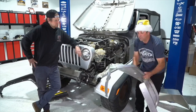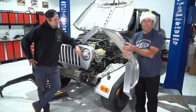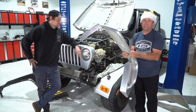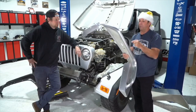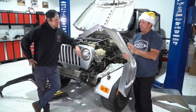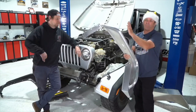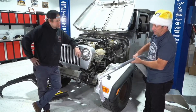The tubes on all of our fenders are 3/16 inch thick — a real thick-wall aluminum. Same on the JKs: anything we do in aluminum, whether it's a tire carrier or fender, is 3/16 or 0.188 inches. That gives you a lot of room to carve away and refresh it. You can get that nice brushed aluminum finish right back, and it looks great.